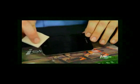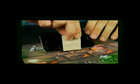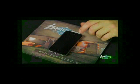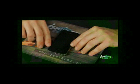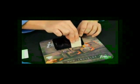Next, lay your device on its side and tilt it at a slight angle. With one hand, gently hold your device so that you are securing a small section of the film as well with your fingertips. Using medium pressure, begin to squeegee the bottom half of the film, making sure to work away from any speaker or button openings. If solution does enter these areas, simply dry it with your microfiber cloth or lightly blow into the wet area to remove any solution. Then, flip your device onto the opposite side and repeat this process.